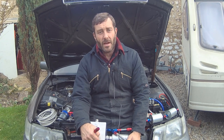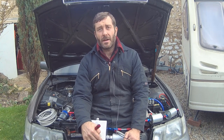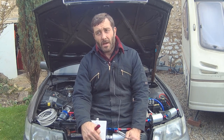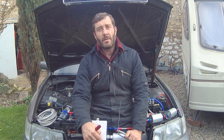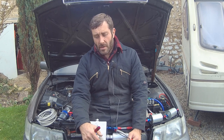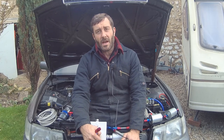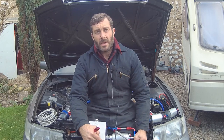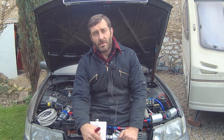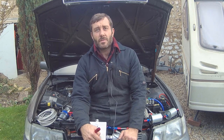We've done five or six drift days now, still running seven psi on the boost, and the car runs brilliant. The only issues are that it keeps cooking coils on second hand parts, and it overheats terribly - you have to do five or ten minutes running then give it a rest. We think the main reasons are the enormous turbo it was never designed for, and the fact that it's running weak on fuel and has too much ignition timing because it's still on normally-aspirated ignition.